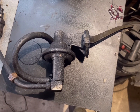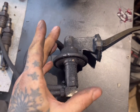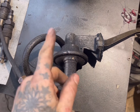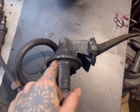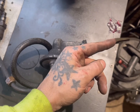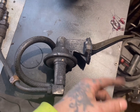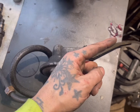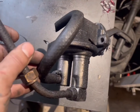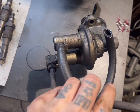On to the mechanical fuel pump. This pump from my application wasn't bad, but I don't believe in rebuilding an entire system and leaving the original mechanical fuel pump. Two good brands I found are Delphi and Carter — people swear by Carter, I've used Delphi and never had a problem. There are two different actuator rocker rods that ride on the camshaft. With a redesign the older ones don't look similar but they do match up. The longer port goes to your fuel bowl or fuel filter; the shorter one is the feed.